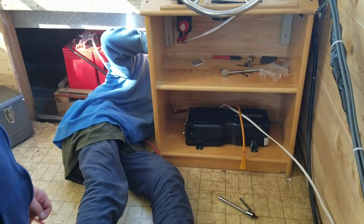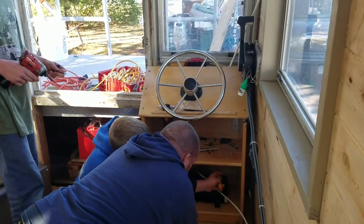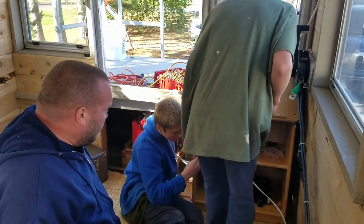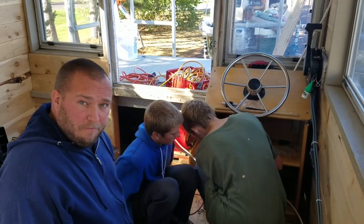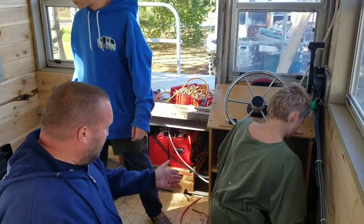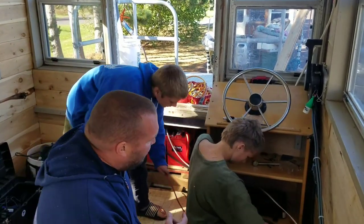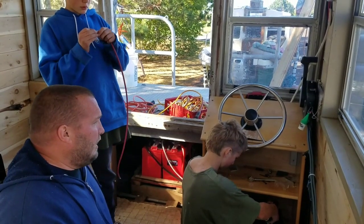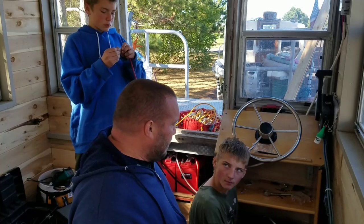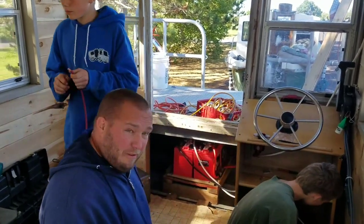It does 70-amp charge back-feed. Brenton was asking if he could do a shore power setup, and I was like, well, you'd kind of need more equipment — but it turns out we don't, because this thing will let you just plug in the shore power cord and that'll let this unit run as a charger, still provide AC to the boat. So it's like an extension cord coming out that I could plug into a generator and back-feed power into the batteries? Yep, up to 70 amps to charge the batteries. That's a kick-butt unit. It's a modified sine wave — a lot of people prefer a pure sine wave for higher-end use, but this is still a very high-end unit. I'll put a link below to that unit.